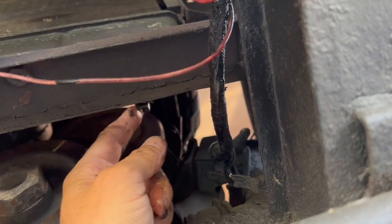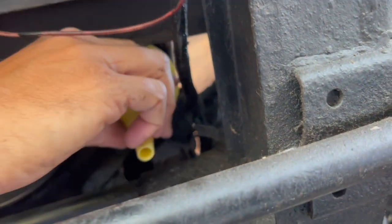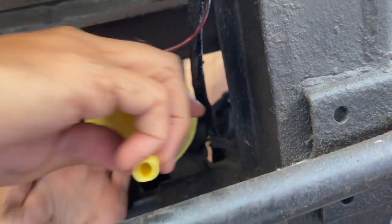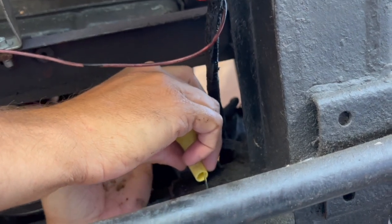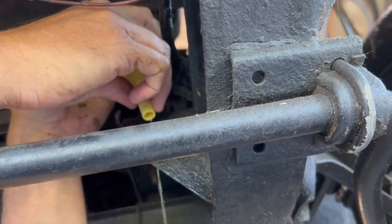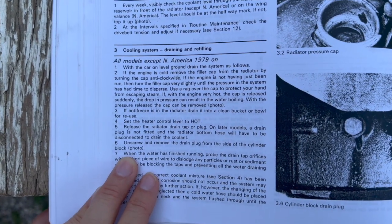While I'm up here I just want to show you guys my belt — it's frayed a little bit, which I believe I mentioned in another episode, but that isn't good. Thankfully it's not ripped all the way but that may cause us some issues in the future. Now my dad is going to get underneath the car and unscrew that so we can drain as much coolant as we can. We're opening it up and putting it into a clean bucket for reuse, as the manual says. Turning this, the radiator fluid is going to come out — we're using a little funnel to catch it. Looks like it's working — we are draining the antifreeze.